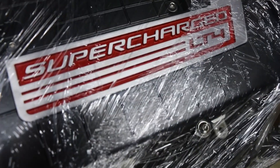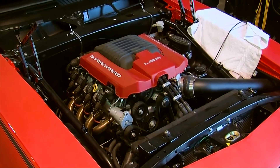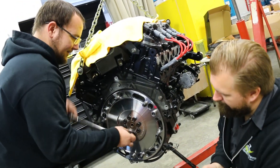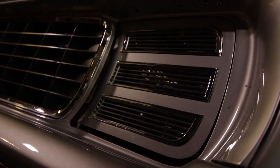This was a tall order, but modern technology provided the solution — an LT4 supercharged V8 engine. We've done many LS type engine swaps into first generation Camaros in our shop, but the LT has its own set of challenges. The LT swap is similar in a lot of ways to an LS, because the engine dimensionally didn't change much. A few critical things changed: the motor mount pattern, the exhaust manifold slash header bolt pattern, and the bell housing pattern. Fortunately, the aftermarket has been quick to come to the rescue. This particular car, the bigger problem was dry sump — finding room for an oil tank and making that work behind the headlight with the RS system.